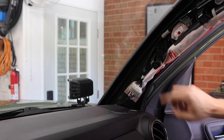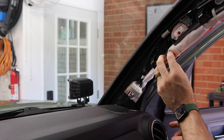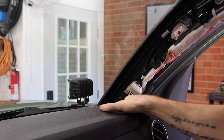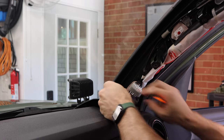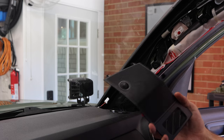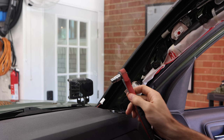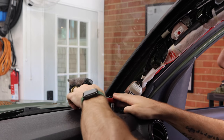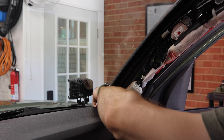This is actually your side curtain airbag — well, one of them. Pretty interesting stuff. If you're ever running a dash cam or something like that, it is really important not to cover these lines up because you want that to be able to deploy safely. But in this case, we're just going to come down here and pop our little plastic cover off. Again, I use my pry tool for just about everything I can. Now, depending on the model of your truck, you might have a little automatic light sensor right here — this is what determines what the lighting is outside and turns your headlights on and off, so you're probably going to have to unclip that if you do have one. Now we are going to get to actually loosening up the old speaker. For this speaker it is also a 10 millimeter bolt, but you are probably going to need a shorter socket to get this out just because of the windshield. You should be able to loosen it up and then undo it the rest of the way by hand, and that should come out pretty easily.